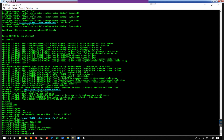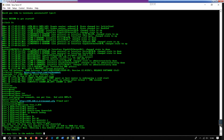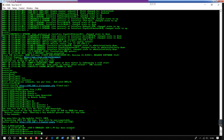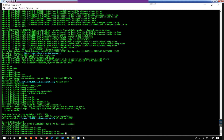And then we're going to do a crypto key generate RSA. I'm going to do 1024 bits to activate SSH version 1.99. Alright, and now I'm going to establish a username. I'm going to give myself max privileges — privilege 15. And the secret is going to be Jowers.